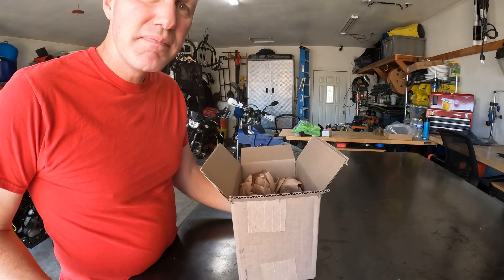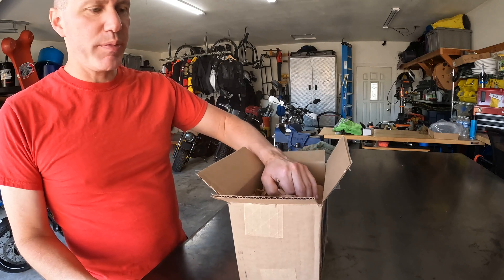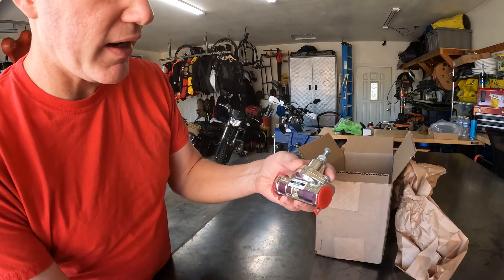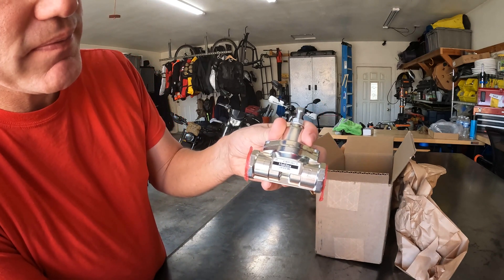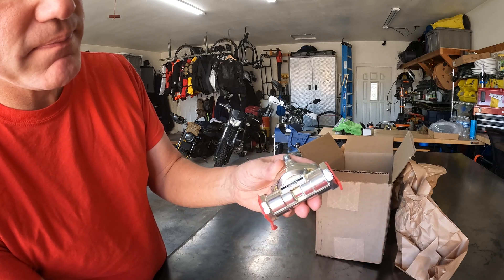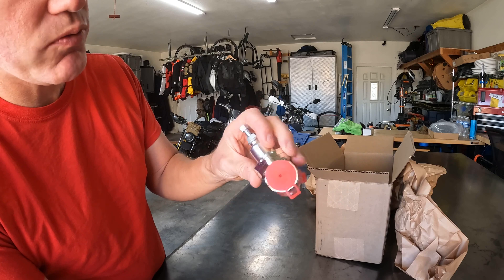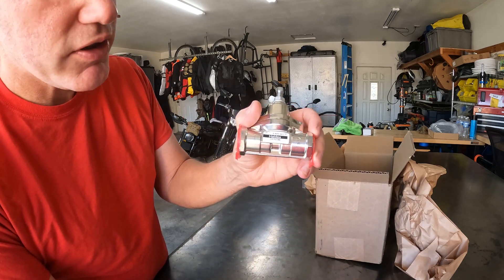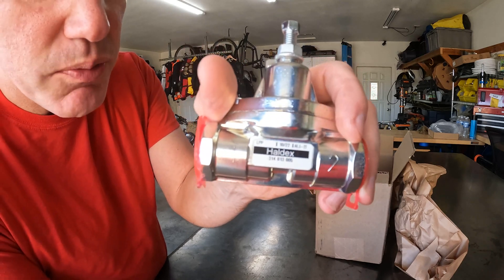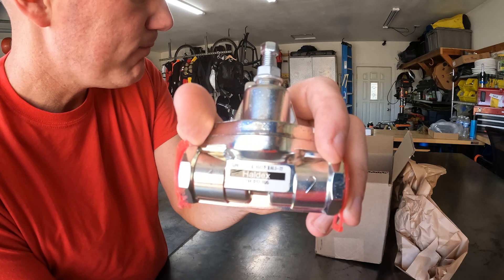Let's open this up and I'll show you what it is. I don't know how long these are going to last and I don't know if I'll be able to install it today, but we're going to give it a shot — about 100 degrees out here today. So here we go. You guys recognize this? It's super shiny in my hands, but originally they were probably shiny like this; once they're on your truck they change colors and get painted with flat paint. Anyway, this is a brake protection valve — it's on your wet tank. Been looking for one of these for a while and I'm glad we found it. I think that's the part number right there. You may be able to find it at an alternate source, but I will leave a link in the description.